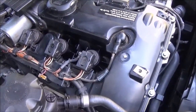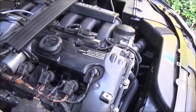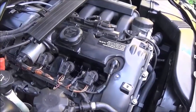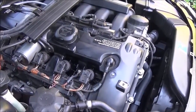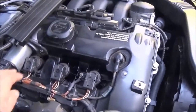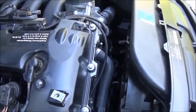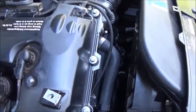The steps to put it back together are the same in reverse. I'm going to leave the cover off — I'm taking it to BMW on Monday and I'm going to ask them if there's any reason that oil could have happened or if it's just spilled oil, which is what I'm leaning toward. Cylinders one and two look fine. The valve gasket cover on this car has definitely been changed — the gasket is almost brand new. The valvetronic motor eccentric could stand to be done but it looks like engine dirt as far as I can tell.